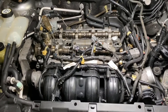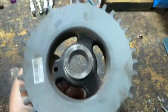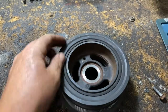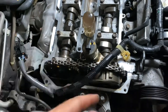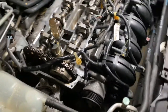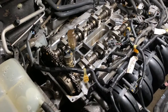It's a little bit different than any other cars. There's no keyways in the crankshaft pulley - I'll show you the pulley. There's no keyway there, so basically this just turns freely without the bolt in it. So you can't just line up marks on the timing chain with the sprocket and you're good to go. That's not how it is in this type of engine.